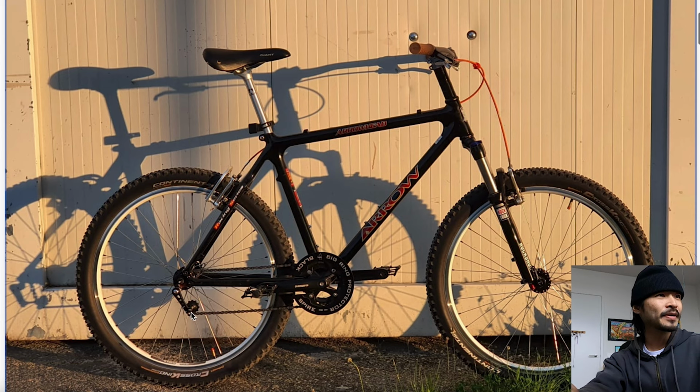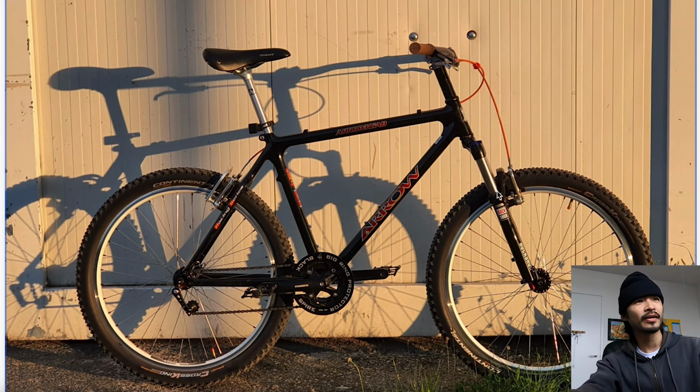And then he's running single speed, I'd say his chain is too long for the single speed. I think he could make it a little bit shorter because he might not have enough tension on the chain tensioner here. And then the other main thing, he said these were 100 mil travel, but I'm pretty sure these aren't 100 mil. They actually look way longer, like 120 or 130.